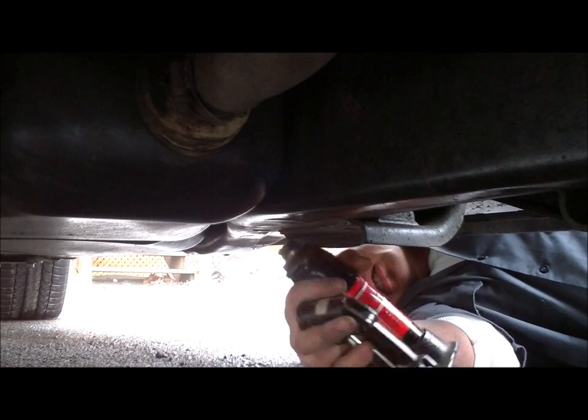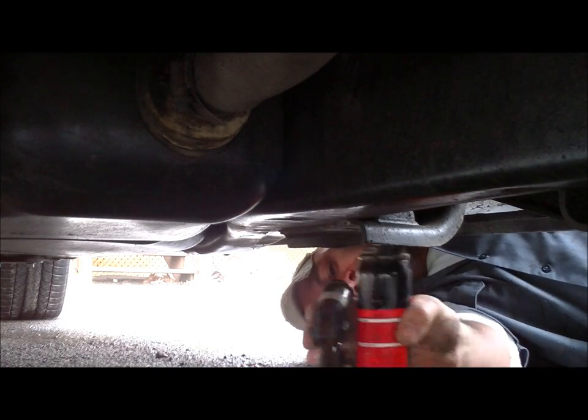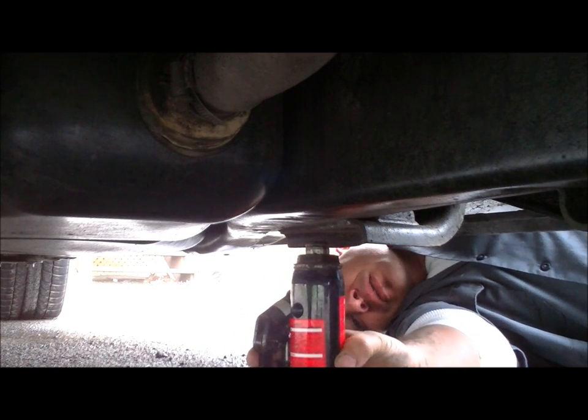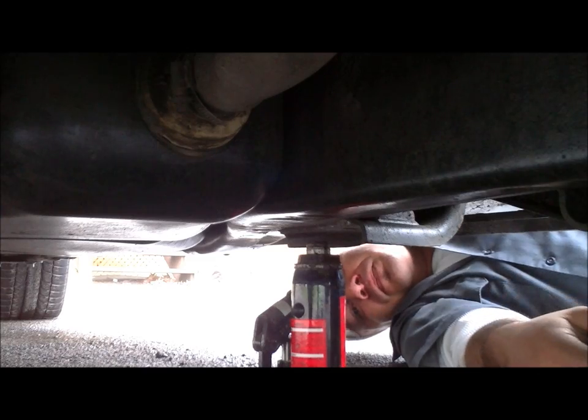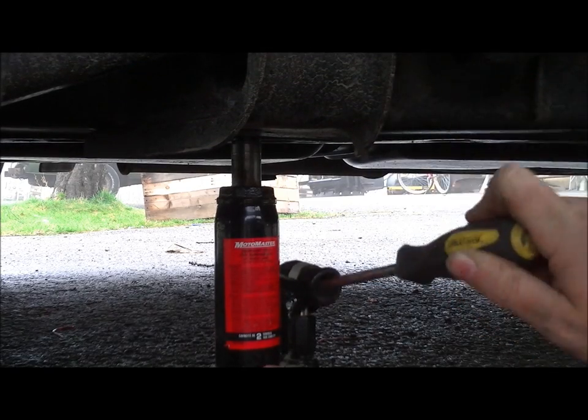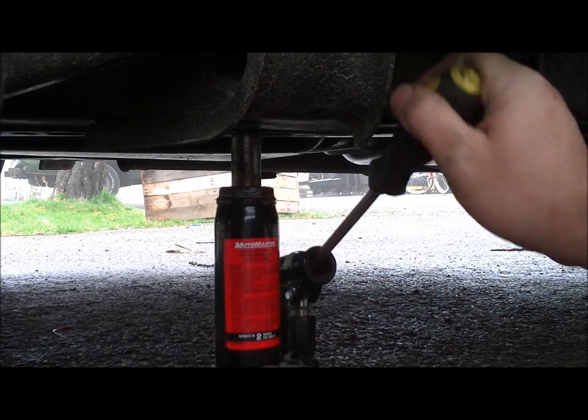I'm under the vehicle now. The first and most important thing at this stage is finding a good solid place on the vehicle — part of the frame — so that the vehicle doesn't fall down and crush your little piggies. I'm choosing this part of the frame right in here — makes for a perfect perch for the bottle jack. We'll use the Phillips head screwdriver simply as a lever — not as a screwdriver, just for the length and leverage. You can see the vehicle lifting just a little inch at a time. We're only going to get about six inches of lift, which is probably more than we actually need.